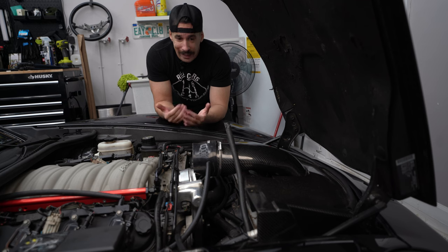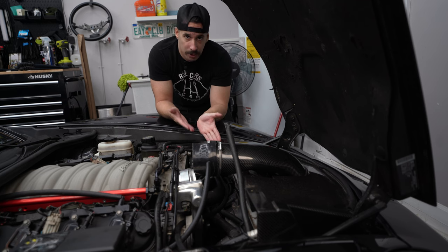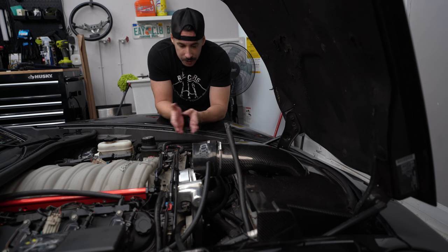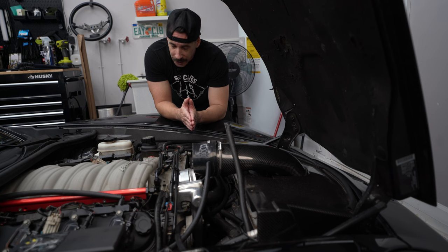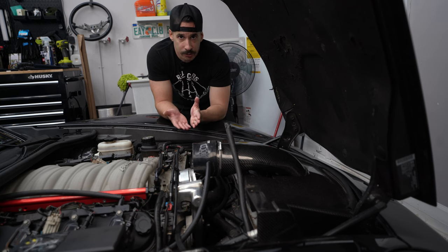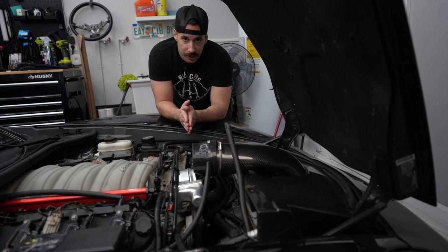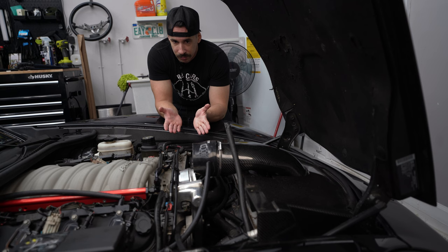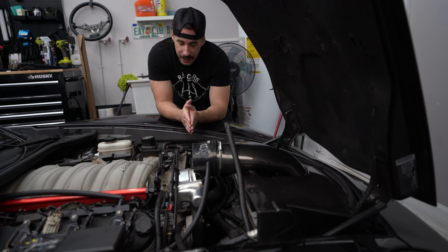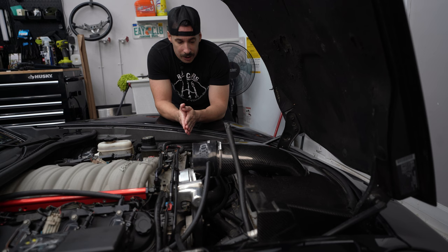So initially, when I slid off track, the only impacted components are going to be the lower part of the car. My front lip was completely disintegrated. And obviously we saw a coolant leak. So initially we did a lot of observation under the car, potentially assuming that there was some sort of impact that might have caused either a radiator hose to come loose or get damaged, or potentially worse, the radiator itself to get cracked. Now that's still a possibility, but we really didn't assess the top of the car, because we didn't assume that anything would occur up on the top end of the car.